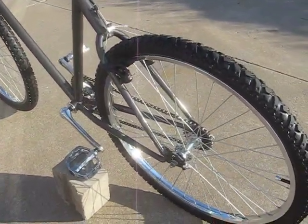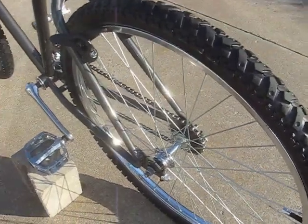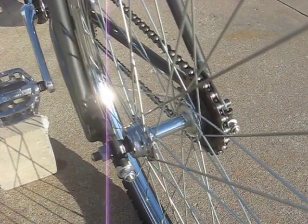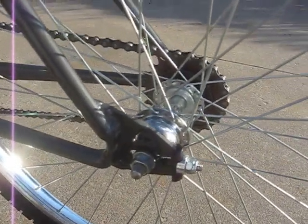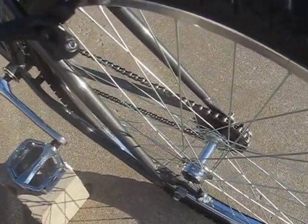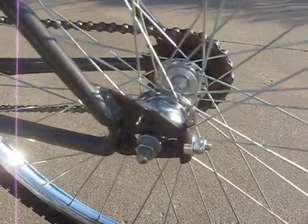These are a set of steel HJC rims. I relaced the back wheel with a 110mm wheel spacing, that of a BMX bike. These dropouts were altered. And after seeing that come together so nicely, and the alignment was so good from the jig that I had used, I had to go forth and make these little chain tensioners.